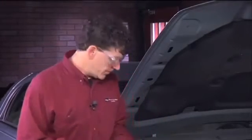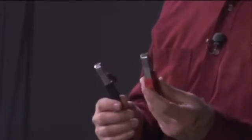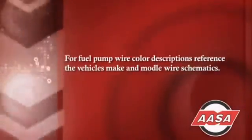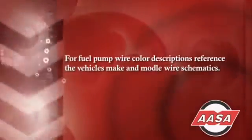Now let's take a look at how to actually do a voltage drop test on a live car. The first thing we need is our digital volt ohm meter leads. I'm going to use some long jumper leads that run all the way back to the fuel pump. These jumper leads are connected to the terminals on the fuel pump and allow me to access the fuel pump while I'm under the hood next to the battery.